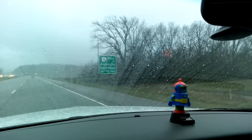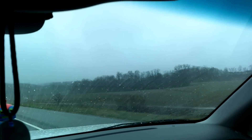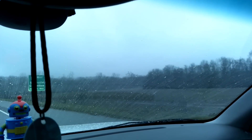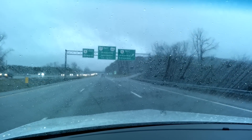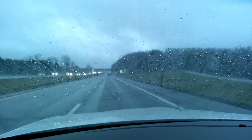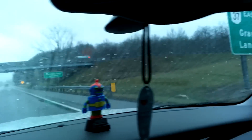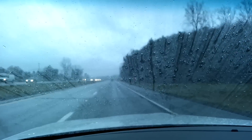Now we have a nice rainy day and I think I'm going to have to eat a little crow. The Rain-X side is really clear — the rain beads are very small, and the wind blows them up and over the windshield so you can see right through them easily. On the Turtle Wax driver's side, it's still beading up and running off, but not nearly as fast. The beads are much larger and not breaking up like on the Rain-X side. So Rain-X is actually working a lot better. Rain-X versus wax — wax loses.